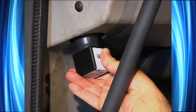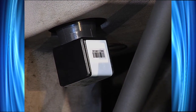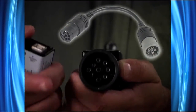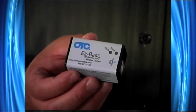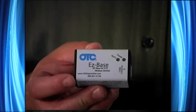It provides the ability to slide onto the truck connector, but if I need to work on a J1708 six-pin connector, there is a cable to physically convert from nine-pin to six-pin. It also has a wireless EasyBase that is 802.15.4, set for 100 foot of wireless signal. This device will tell you that it is communicating wirelessly via the LEDs, plus that the power is there.